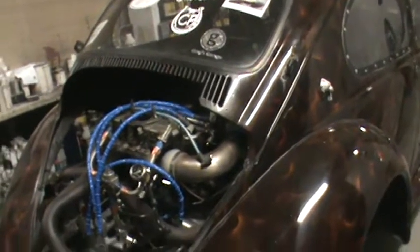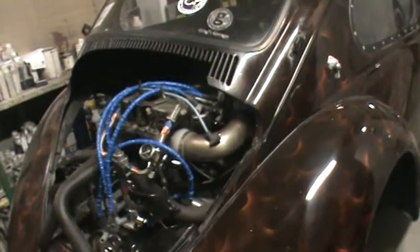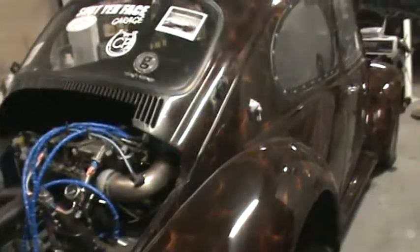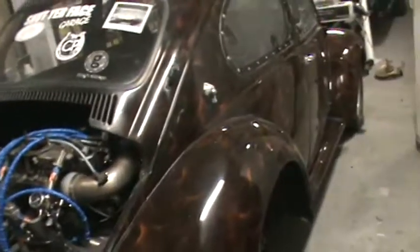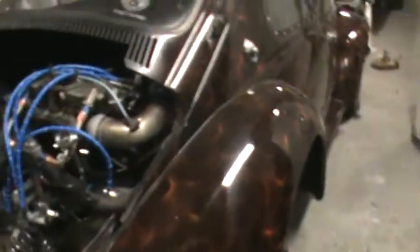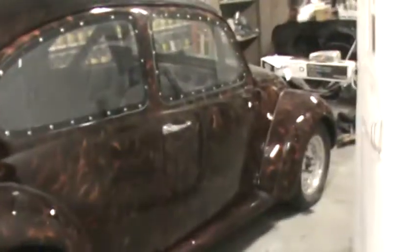I know they do make some badass oil pumps now, where the pickup actually bolts to the bottom of the pump. I know if you buy an aftermarket pickup and pan, it usually has the bracket welded on it to attach the pickup tube to the bottom of the pump, and eliminates you having to weld the tube in the pump. So hopefully that answers some questions.